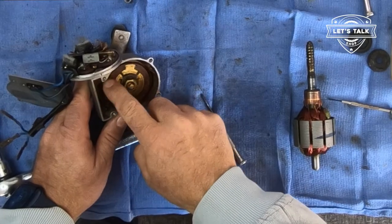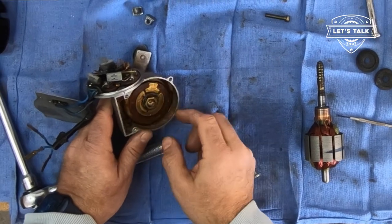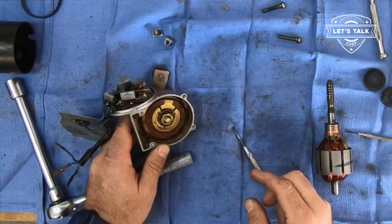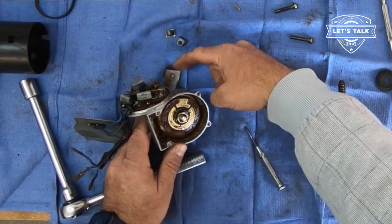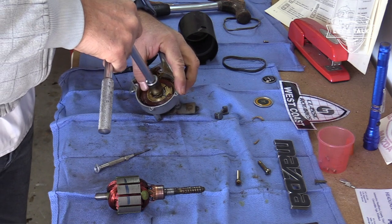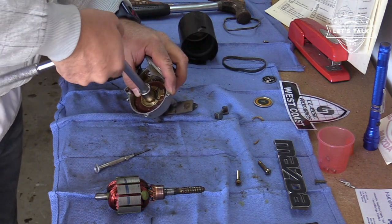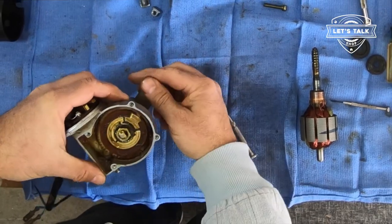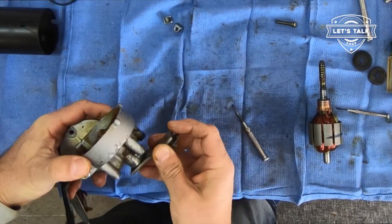So this disc doesn't lock, but you want it to, right? When it comes to tightening this nut here, you want this tang pointing at that tang. The key is to tighten this down just enough for that to lock. So now the disc won't spin freely, but everything else will, as an assembly.